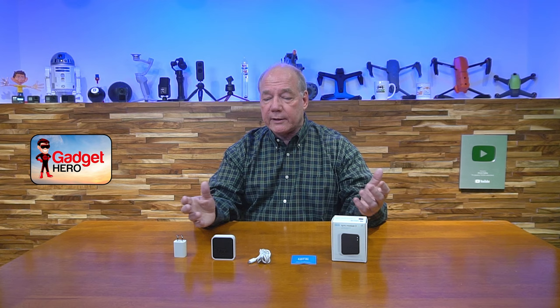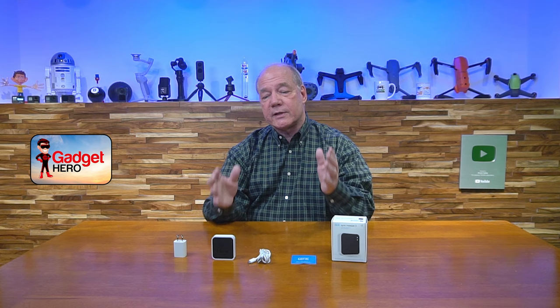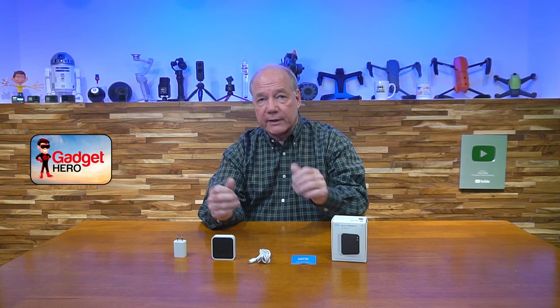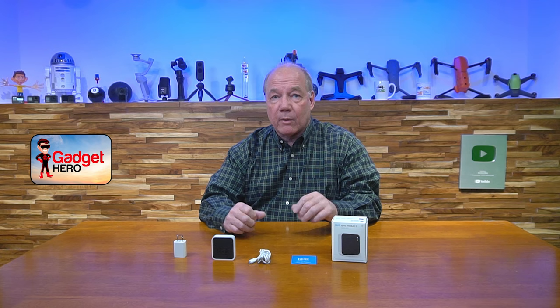I thought I'd start with an unboxing of the product in case this is your first time looking at this. Essentially what the Sync Module 2 does is create a collection point for up to 10 cameras that connect to the Sync Module, and then it connects to your local network. That's an advantage because a lot of home cameras have their own connection to your Wi-Fi network, and the challenge is you only have 256 locations you can actually assign to, so you can run out pretty quickly with a lot of home automation devices. Having a hub like this that gathers up 10 cameras at a time and handles handshaking, recording, and moving video means it only needs one address on your home network — a big advantage.